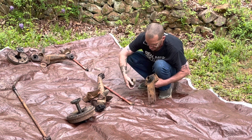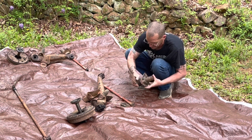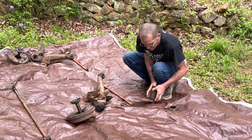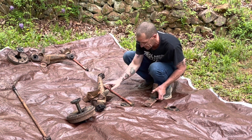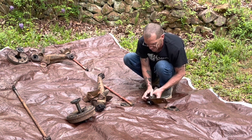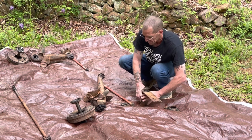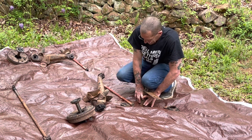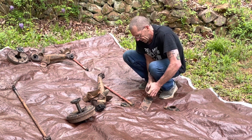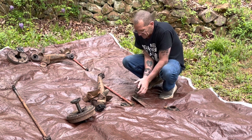If I do air ride then I don't put the torsion bars back in. I haven't decided yet, but if I do air ride that means I've got to repaint the chassis again because I've got to weld brackets onto it — a suspension bar for the airbags — and modify the trailing arms. I still have to get all this stripped to get it ready for paint regardless, and if I do airbags I need it stripped so I can weld the bottom brackets for the airbags onto it.